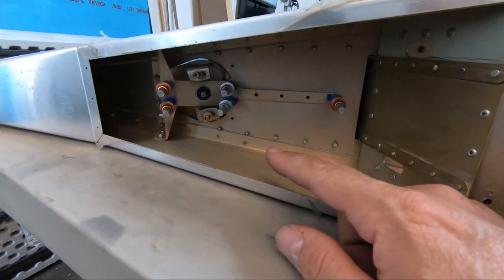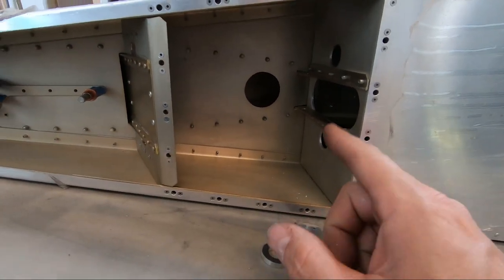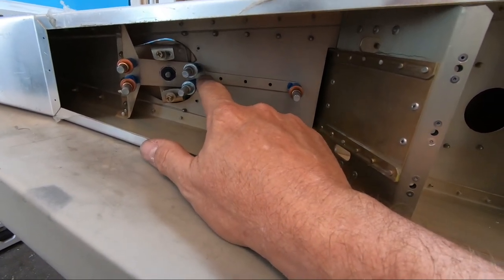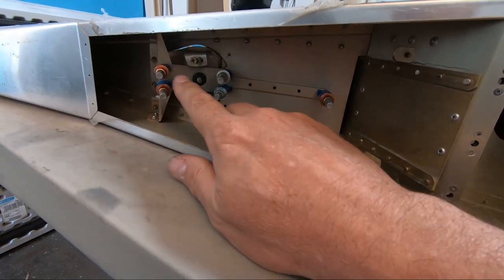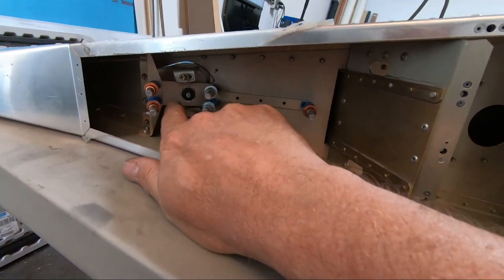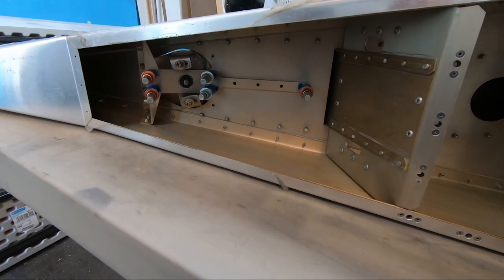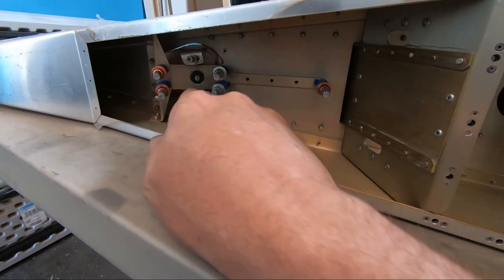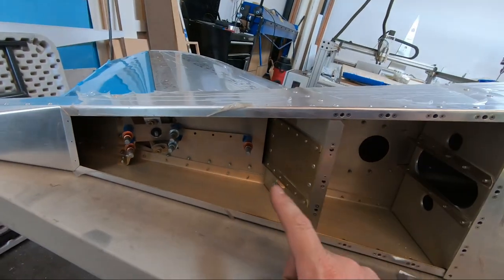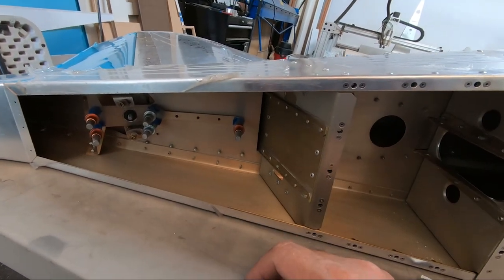There are other things we need to finish on the rudder assembly and vertical fin before I attach the rear fuselage — I can finish the bell crank afterwards. I'd like to get all the rivets installed in here and get the back edge of the fin installed, then finish the rudder cable plate that attaches to the bottom and finish what I need to do for this lower bearing. I wanted to put a retainer over the top of this, similar to what we did on the forward horizontal bell crank, just to keep that bearing from wanting to push out of the bottom. I also purchased the Lexan that's supposed to cover over the top of this on the back half, so I can go ahead and get that piece cut and the holes drilled.